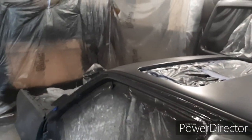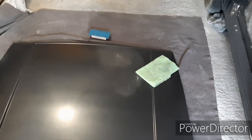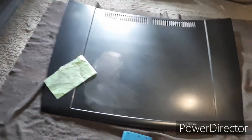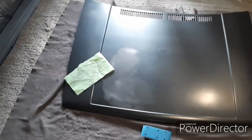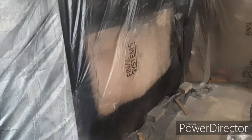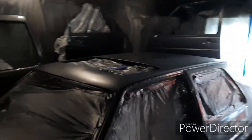I'll leave the sunroof until last — I'm more interested in getting the roof finished and getting the bonnet on, as those are the big panels. The plan is to finish the bonnet, get some paint on it without putting runs in it, just dust it with light coats on the floor, and once I'm happy it's got a nice even coverage, hang it back up and do the same with the roof. Then ideally tonight I want to get clear coat on the roof, that door, and the bonnet.